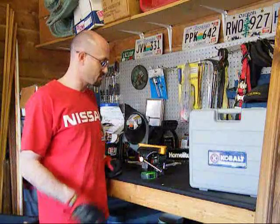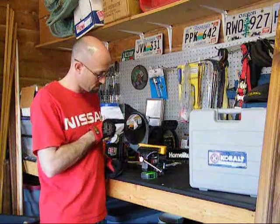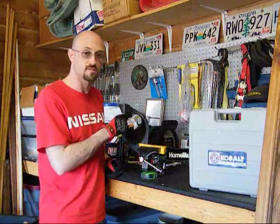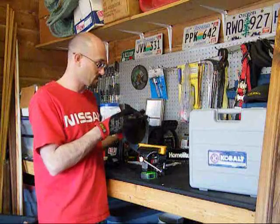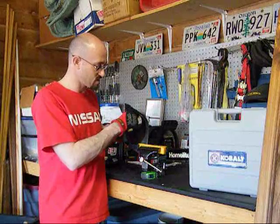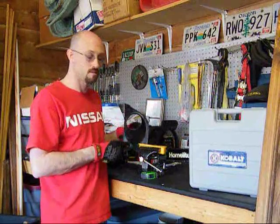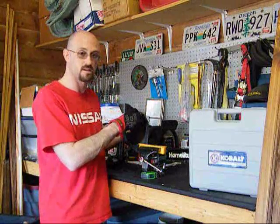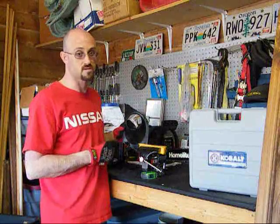We're done with the first one — it took me about 15 minutes, just taking my time. If you notice around the edge of the back, there's a ring, and that's where they differentiate between fog light and non-fog light finishers. What you want to do is cut the inside all the way up to that ring, that raised scribe edge, so the fog lamp will fit directly in there.